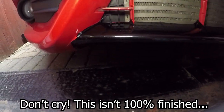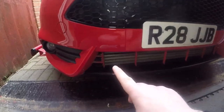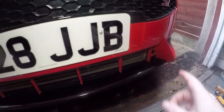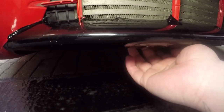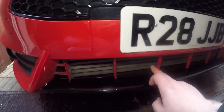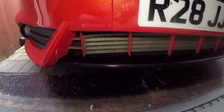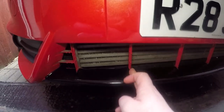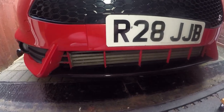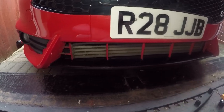The lower lip has been wrapped. By far it's not the cleanest or most professional, and what makes it difficult is you need a piece that goes all the way along and up to the other side. I've tacked it underneath the bottom of the bumper just here. The difficult part is when putting the wrap on, you can't put these bits down until you've cut slits — and if you've got a stretch wrap, cutting these pieces can be tricky because cutting in one spot causes stretching elsewhere. We've managed to get it done pretty well though.